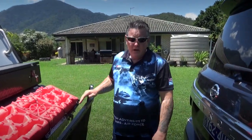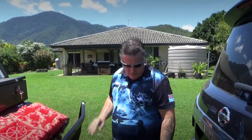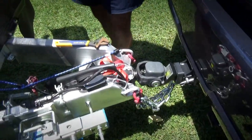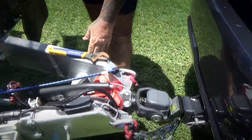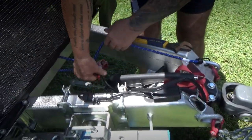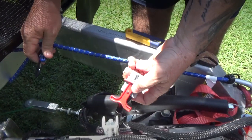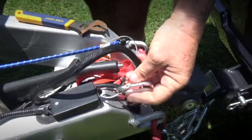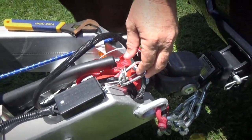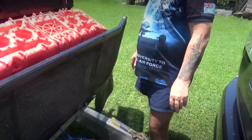Starting at the front — we've made a few modifications. We put a DO35 hitch because most of our family are using it; it comes standard with a different hitch. You've got your handbrake up front — that's all standard — and heavy duty chains. There's also an Anderson plug that comes standard, which puts power inside from your car to the BMS30 inside the van. It also comes with a breakaway system: if you have a major mishap it disconnects and locks the brakes on the caravan. It came standard with an ARC 30 jockey wheel — pretty expensive, top quality gear.